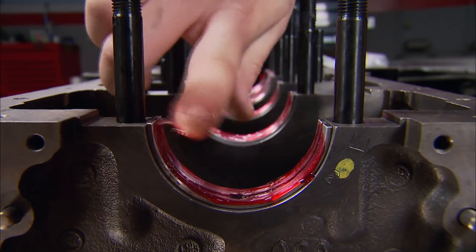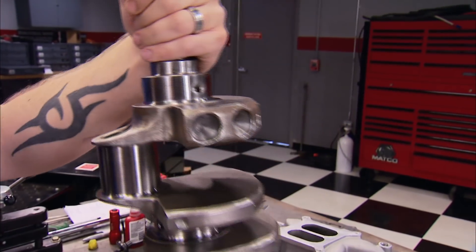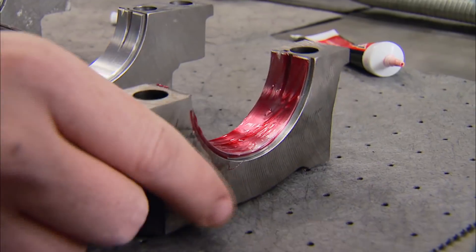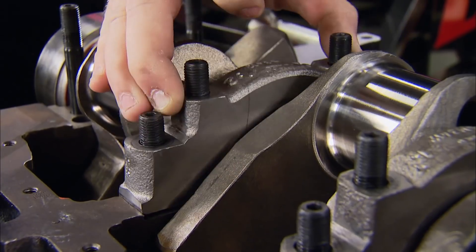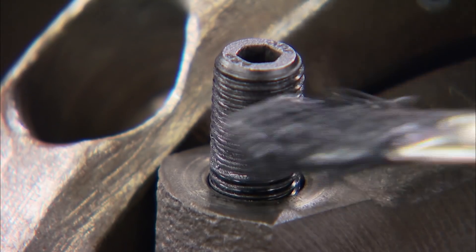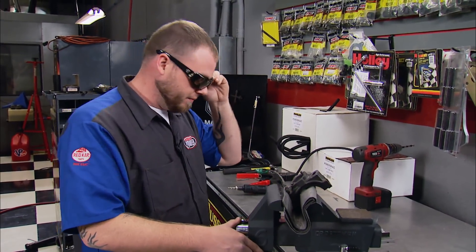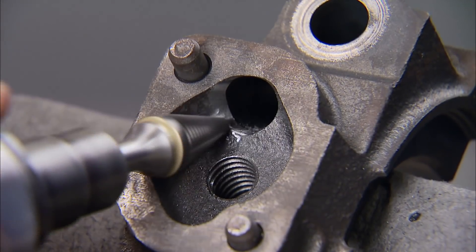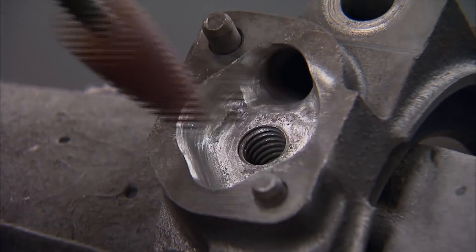We'll prep the bearings using Torco assembly lube from Metal Brock throughout this build. Our crankshaft is a repurposed stroker crank from Eagle — it stayed standard on the mains and rods. By not buying a new one or regrinding this one, we were able to afford the balance. To keep it all together we use ARP studs with their ultra torque assembly lube. Here's something you can do at home for free to make a big improvement in oil flow: where the oil pump feeds the engine, this wall can be a bit restricted, so we're going to open that up. In racing, every small improvement can equal big results.